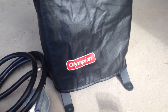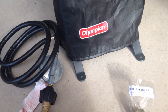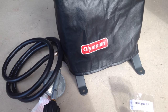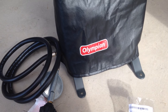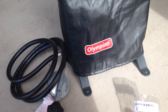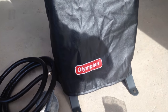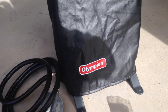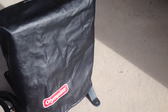These radiant heaters apparently do not put out carbon monoxide, though I'm going to have a carbon monoxide detector in the van just in case. They do consume oxygen, so they recommend you have 24 inches of free air opening — basically open a window. They recommend a high and low opening, so I'm going to open the fantastic vent a couple inches and then a side window, and supposedly that should be good to go. One of these days I'm going to actually run this in the van and test it out, maybe just in the garage or driveway, and then give you some more results.